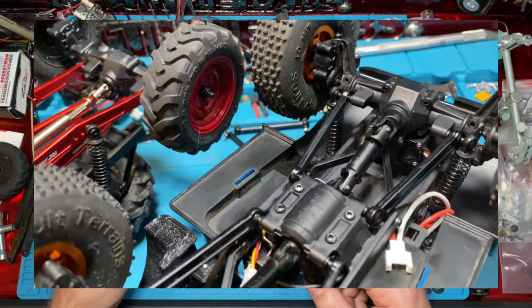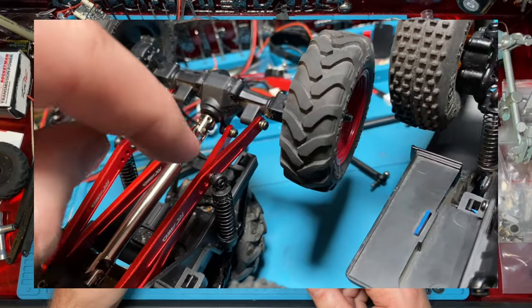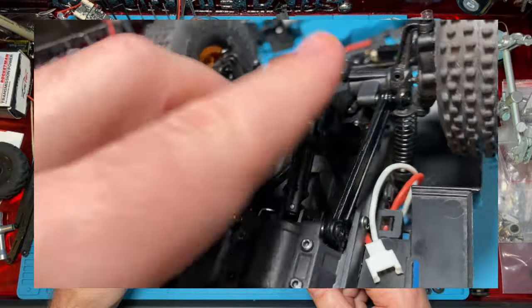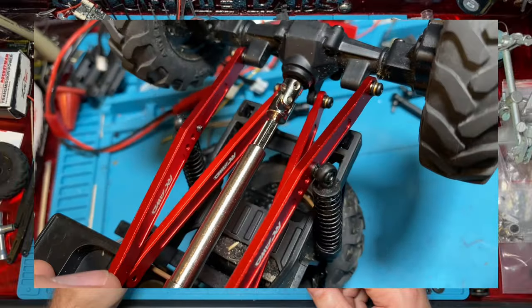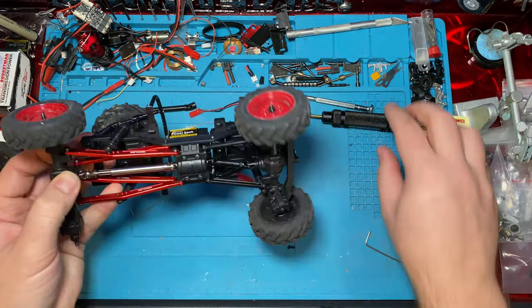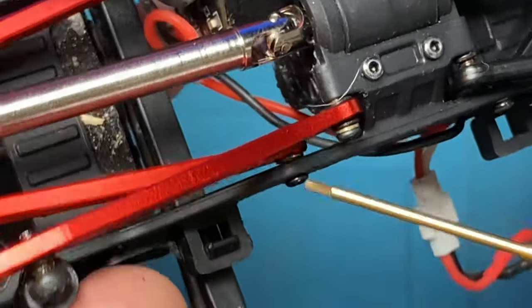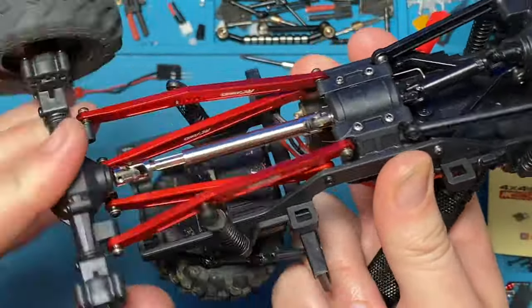I totally forgot that when we switched over the McHugh links, we actually just pulled the pivot balls out of these links and put them into the shock so we can mount them. So these silver balls — they definitely go into your shock so that you can put a screw through. We're just using the pivot balls from the links. So you can do the same thing: pull these pivot balls out, put them in your shock, and then you have an actual pivot ball in there versus a screw. We did use shorter screws here and the rest are all longer screws. Also, these have sleeves in there — it's a bushing through the chassis — and you want to put the spacer side towards your link. That'll give you a little extra space and help with your articulation.